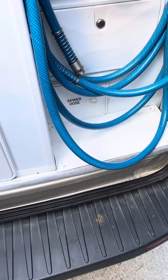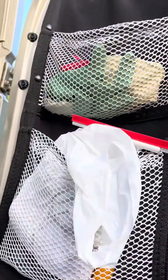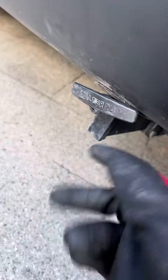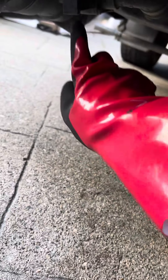There's also the sewage sewer hose. Put on the gloves, which are located here. This sewer hose is what's going to help you empty your black and gray water. It hooks up to this, twist and lock it. You typically want to empty the black water first — you pull it, and once you're done, shut it, then chase it with gray water. See the gray water?